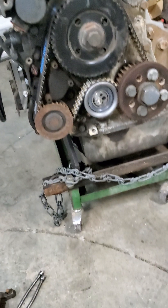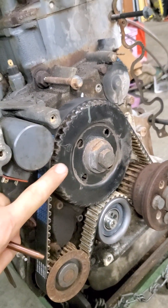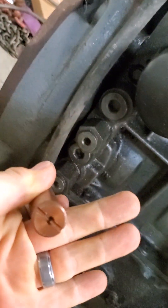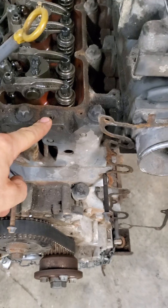The only way you can time this engine is when you buy a new timing belt - it comes with timing pins. The crank and cam timing pins are exactly the same. The cam pin goes on this side of the engine: remove that 10-millimeter bolt, put the pin in all the way, then carefully rotate the cam by hand until the hole in the camshaft lines up with the hole, screw it in, and tighten it with a flat screwdriver. To time the crank, manually put the crank at top dead center of the first cylinder.